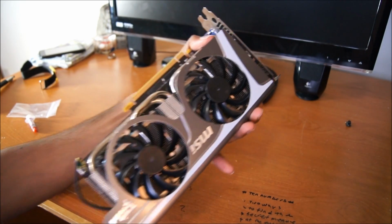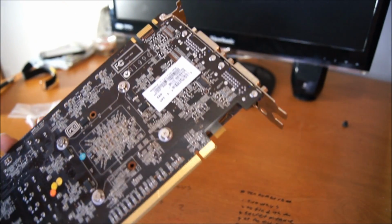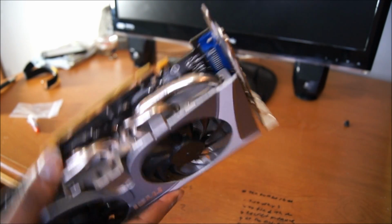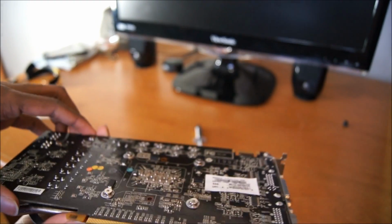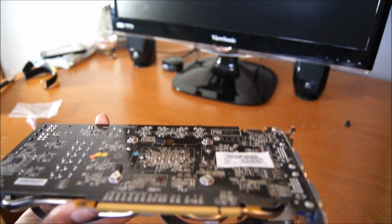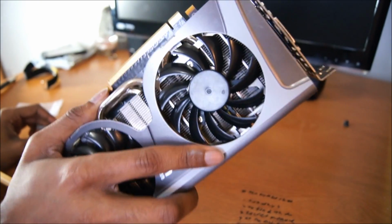And so there you have it. I have reattached my heatsink. I have shown you how to do it, well, in passing really. What I did was, again, for explanation's sake, I put the heatsink on the table, I turned my card upside down, put my screws on top, screwed them in diagonally, and now, finally, I am ready to put this card back in.